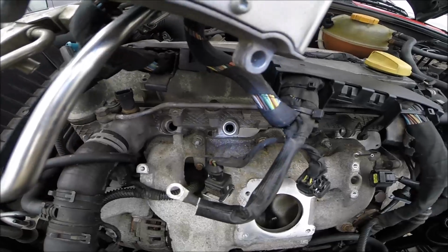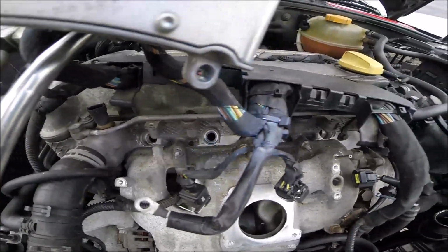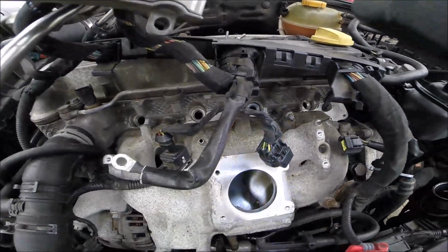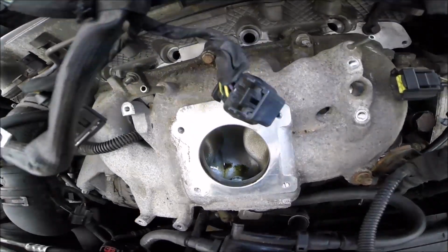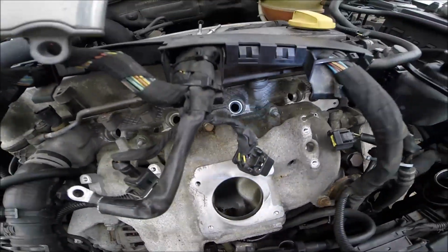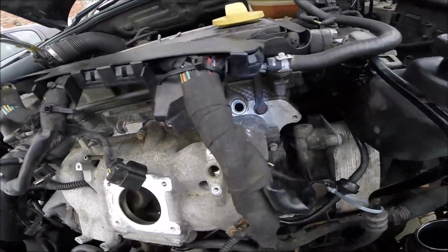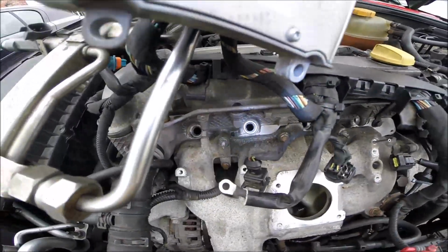The second cylinder has a little bit of oil. I know about this because the turbo is a little pissing, so there is some oil soak actually for the second cylinder, but that's nothing very bad. Okay, the others look perfect.